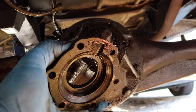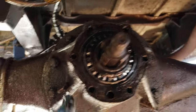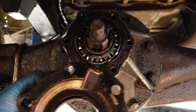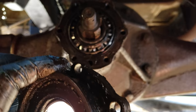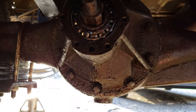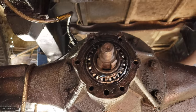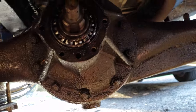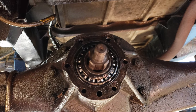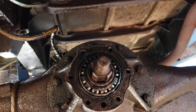I got all the screws off and I don't see a joint washer in there — basically just a paper gasket — and there's nothing of the sort on here whatsoever. It looks like that hole would line up there, so that makes sense. There's no gasket in there, so I'll just smear some Hylomar Blue on there before I put it back together. I won't worry about a gasket because there was none when I took it off, even though the workshop manual said there should be.